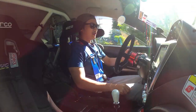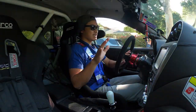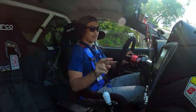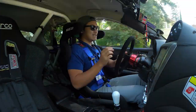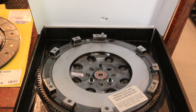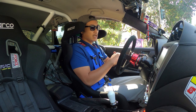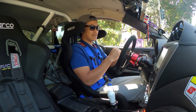You just got to do your research, look, be patient, and sooner or later you'll most likely find a good deal on an STI transmission. First off, you're gonna need the STI trans. It's up to you if you're gonna do the DCCD — if you are, you're gonna need the six-pin connector for the wire harness. If you're not doing DCCD and you're just gonna use the WRX harness, go ahead and remove and set aside the two DCCD pins from the STI trans and save them for later. Besides that, it's pretty easy plug and play. You're gonna need an STI starter, a new clutch, the shifter components — cables, linkage, stuff like that. You're gonna need a rear diff. You can do what I did, which was an R160 conversion using a bug-eye rear diff, or you can get an STI rear diff. Either way you're gonna need a new rear diff, as the final drive gearing is not the same for the WRX and STI.